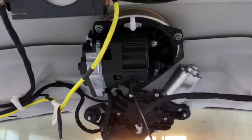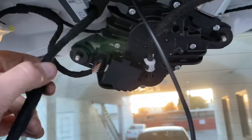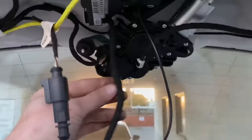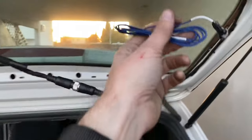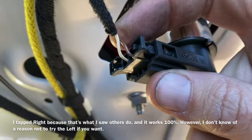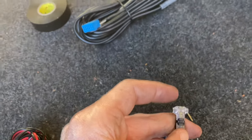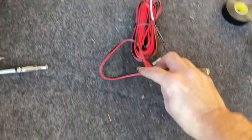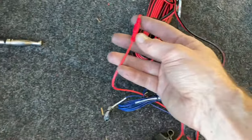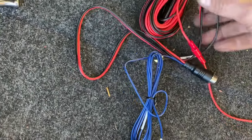Starting to route the wiring. We've installed the badge and the wiper motor, reconnected the wiper fluid, reconnected the electric harness under there, and now we're just starting to mock up. So here we have the power for the badge — that's tied on. This is the lead that we're going to tap onto the reverse wire. Brown is ground, this makes it the power. The seller I got this from — I'll provide a link — made this little alligator clamp, so I'm just going to use this to tap onto that reverse wire, and that's what's going to trigger the badge to flip and kick up the camera. I can just disconnect this wire so that I don't have to try to force this through all the paneling. I also just wanted to show the routing for the drain pipe — I put it there with a loose zip tie. It's a rubber hose, you don't want to crimp it, but just have it pointing off towards the right side of the vehicle so that gravity will do its job and direct water to the drain hole there, since the other two are blocked.